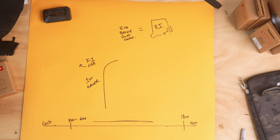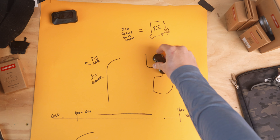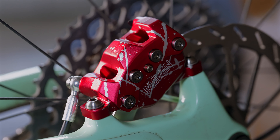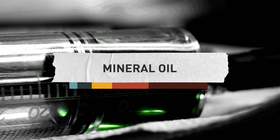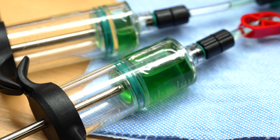Let's do some science. F1 cars have brakes that run very, very hot — they won't even start to bite until about 400 to 600 degrees and can get as hot as 1800 degrees. There's an optimal temperature range, a butter zone. F1 races are tricky because on the first corner the brakes aren't ready yet, and on tight circuits with no straightaways there's not enough airflow to cool them. The same applies to mountain bike brakes on a less extreme level. Mavens have a greater thermal mass than other brakes, so they take a little longer to heat up but resist overheating much better. Once up to temperature, they hold that optimum brake temperature whether it's cold outside or you're descending hard.